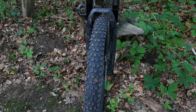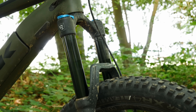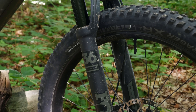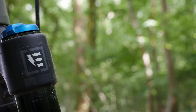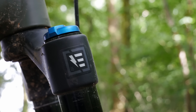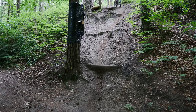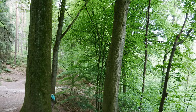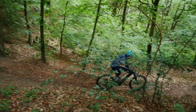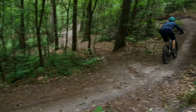You asked what you'd like to know about this bike, and the main thing was battery life and how I get on with the motor. The battery is 500 watt-hours with a 250 watt nominal power output motor, so mathematically that's about two hours of battery life. However, if you're climbing almost vertical slopes the motor exceeds 500 watts and you'll get under an hour. On flat terrain like random fields you'll get about three hours, which is what I get on my local trails.